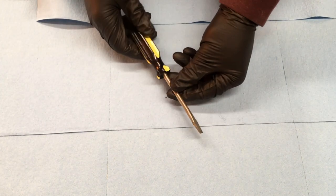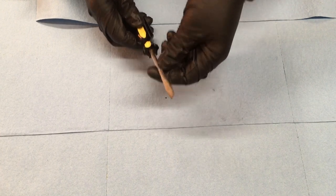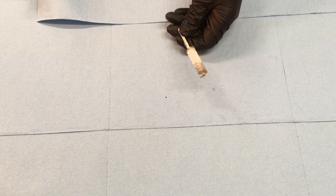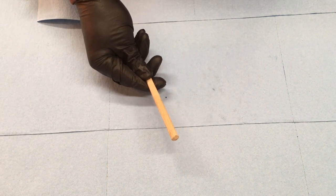Before you get started, you'll need to shape your oak dowel into something like a chisel or a flathead screwdriver. The reason we're using a wooden dowel instead of a flathead screwdriver, and also why we're using a nylon brush instead of a wire brush, is we want to avoid any chance of scratching the block surface with metal, or leaving metal fragments down in the bore where they could cause problems. When cleaning a machined surface, you always want to use tools that are softer than the surface itself. So take your oak dowel, cut it down to about pencil length — about 4 to 6 inches long — and cut a vertex into the end.